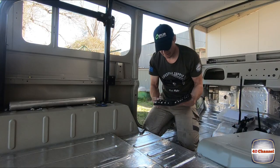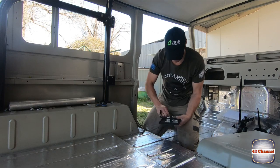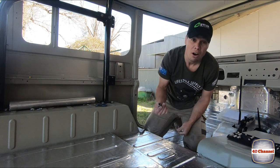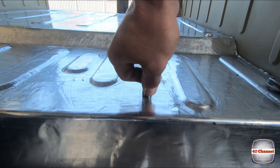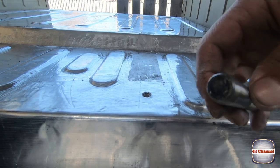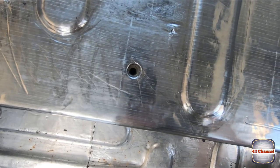As you're pressing it all down and really moulding it into all the contours, you'll actually find these little holes - they'll come up as little indents. All you need to do is get a little hole punch kit. If you don't have one, just a razor blade and cut around it, peel it off - no big deal. But I like to use one of these. Go down to Toolking, grab one of these hole punches, push straight over the hole, push over the top, give it a bit of a twist. That just pulls straight out - look how neat that comes up. Nice neat hole, and there's your seat mounting hole.